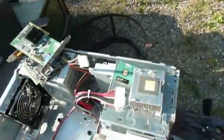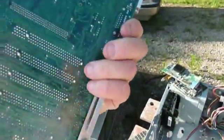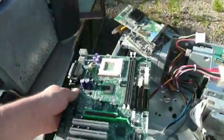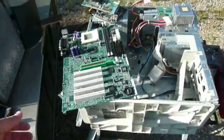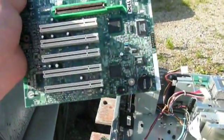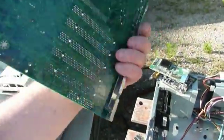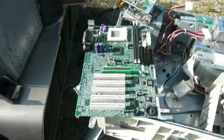So how did I clean this up? Well, apart from throwing cards on the ground when I hit them with the edge of the motherboard, I did the highly scientific and high-end motherboard cleaning procedure that a Kenmore dishwasher can provide. Before you scoff and say "Are you nuts?" — well, I am — but this procedure works as often as not. I know because I saved a number of computers from my own basement flood.